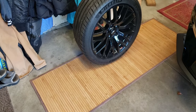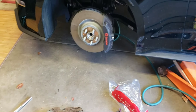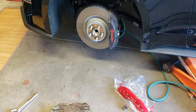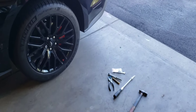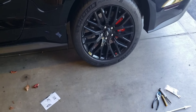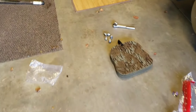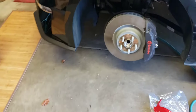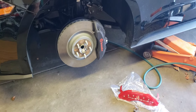I think it's a good idea to, at least maybe if you're in between rotations even, just to pull them off and look them over. Especially if you track the car - you don't want to be cruising down the drag strip at 120 miles an hour and have a blowout. So pay special attention to those and keep checking your tire monitor in the car. They haven't been leaking air, so that's a good thing, but got to keep an eye on it.